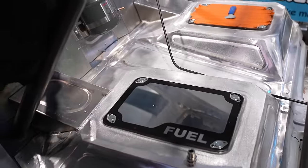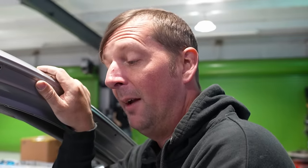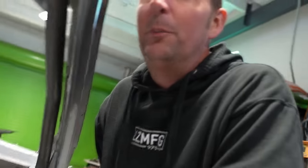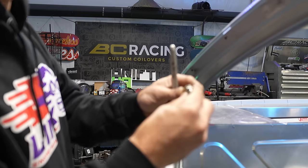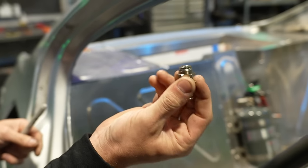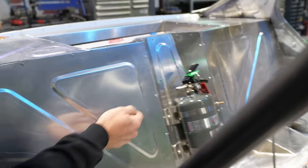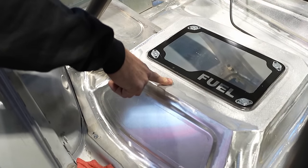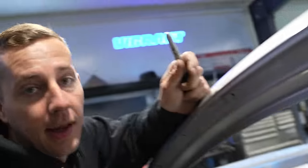We are now working on our fire suppression system. Chris and I went to a basketball game last night — I left early, and when I got back Chris had it already starting to run. We decided we don't want anything in the way of our beautiful back cap area, so everything's going to be hidden, bulkheaded, and real clean. Lifeline gives you these sweet little bulkheads to run your lines through the firewall so you don't just drill a hole and worry about lines rubbing and eventually bursting.